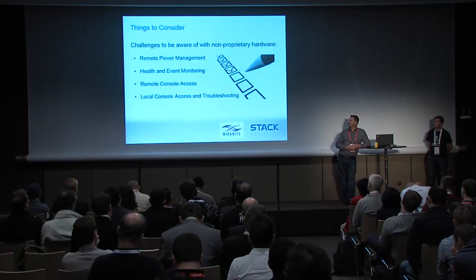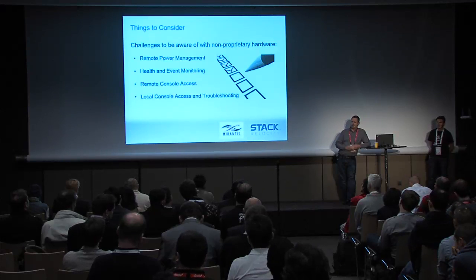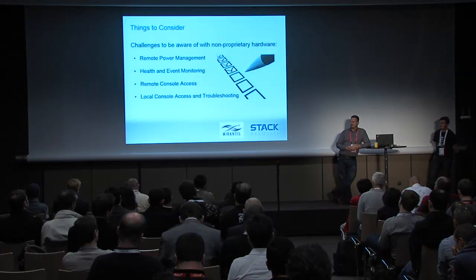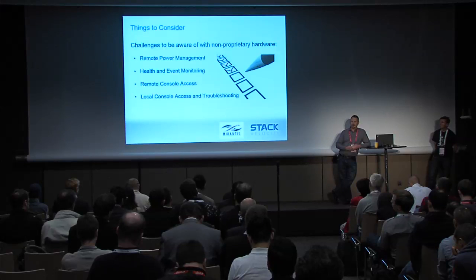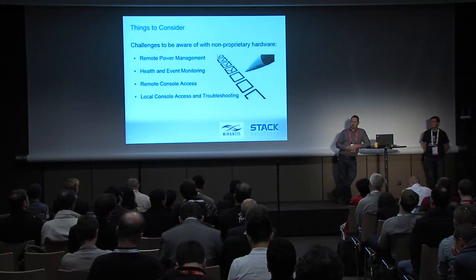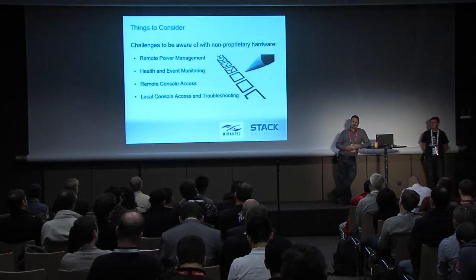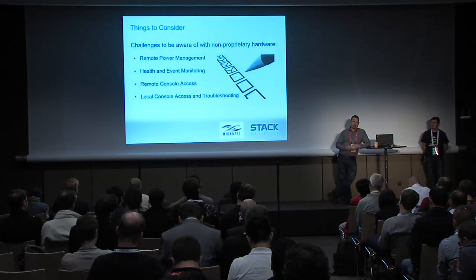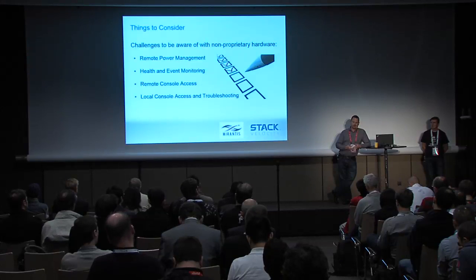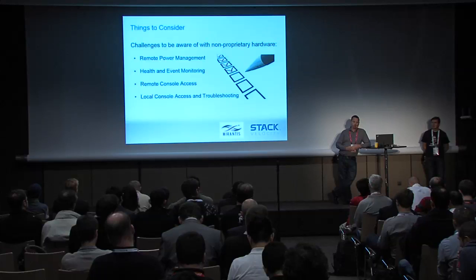IPMI is a universally accepted protocol used on everything from Dell to HP to white box hardware. You can use the same interface for everything, and it really helps you solidify a platform across your entire organization regardless of what brand of hardware you choose. As things like open compute hardware become available, there's a trend towards removing cost of operations — things like video cards or base-level video off the motherboard may be removed. If you walk up to a machine with no video capabilities, it's pretty hard to work on standing in front of it. Think about setting up your toolkit for serial over LAN for remote management, or serial cable connections, so you have a process in place for that kind of hardware.